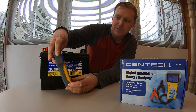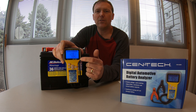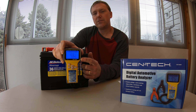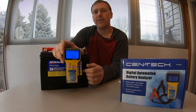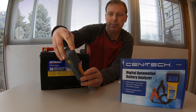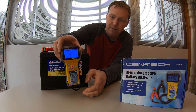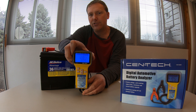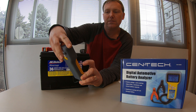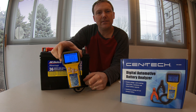This battery is 12.81 volts and 3.85 milliohms. Your milliohms should be somewhere between about 9 and 13 — it can go up to 20, but the higher the number, the worse the battery condition. At the top you can see a bar showing the charge percentage, and it actually says 'good.' If the battery is bad, it says 'NG.' Hitting select shows the cold crank amps you entered — 685 — and this battery actually tested at 688 cold crank amps.